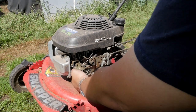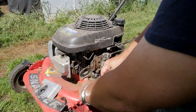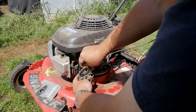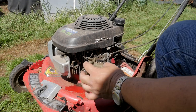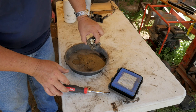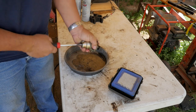There we go, let's turn the gas off. Let's set that aside. That's the governor. All right, let's take the bowl off and see what it looks like. A whole lot of gas came out of it, so it must be clogged in there.